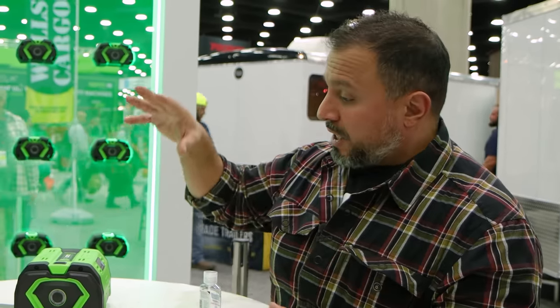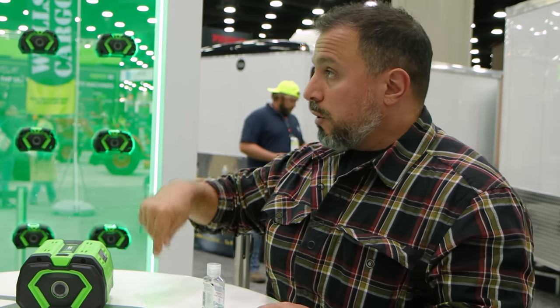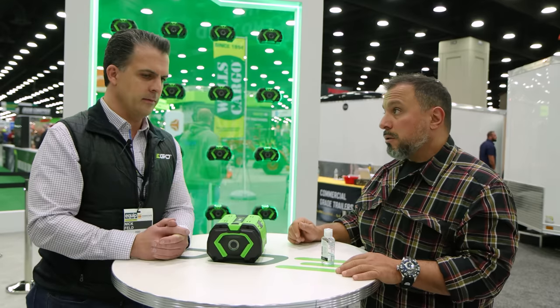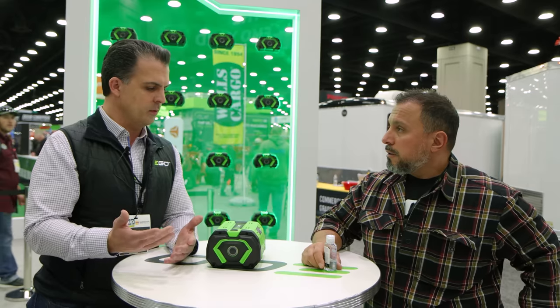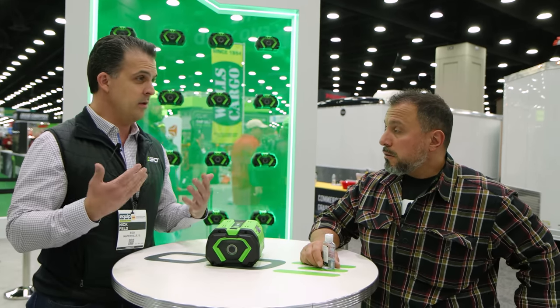So the piece of advice you're giving anyone that's using any lithium-based cell or pack is, if you're leaving your battery-powered tools in the truck overnight in freezing temperatures, don't do that. That's bad. You can look at the manual. All manuals will publish a safe operating storage temperature and operating temperature. The best rule of thumb is keep these in a relatively ambient environment. That way you can go right to work.